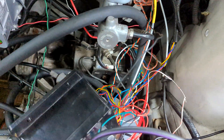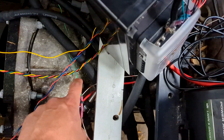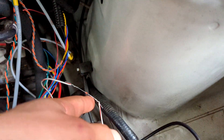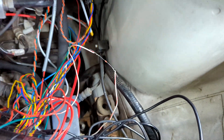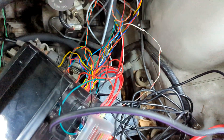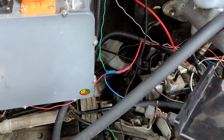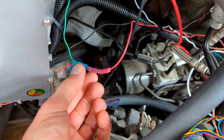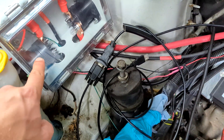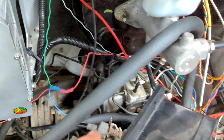For the DC-DC switch right now, when I switch it on, because it's connected at this DC-DC point, the BMS drive switch also turns on the DC-DC converter — so it switches on all the stuff in drive. What I'm going to do is add a diode here so that current can only flow to the DC-DC and you can't get back flow, where when the DC-DC switch is on it feeds all the way back and also feeds the coolant pump and other things on the BMS drive switch. Now I've got two diodes — one here on the contactor line to prevent back flow, so the DC-DC converter switch also powers the main contactor, but I don't want to back feed to the junction box and to the drive output where it powers the coolant pump. So I put a diode there, and I have a diode there as well — that's the direct run to the DC-DC enable input.